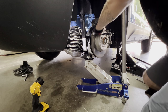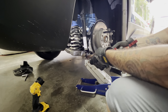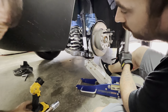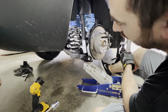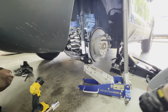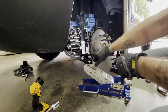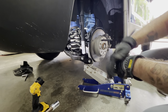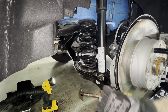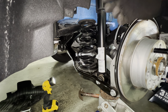Play with the jack a little bit to get the bolt lined up. A little tap if it gives resistance — don't force it, you want the threads to catch. Once the nut is on the back side, lower slightly to get the shock bolt back in. Per B2B Fab instructions, the lower shock bolt torque is 50 Newton-meters. The sway bar end link bolt is 20 Newton-meters plus a half turn. Tighten and torque both 18mm bolts. We were able to get the sway bar end link bolt all the way through, so tighten that as well.